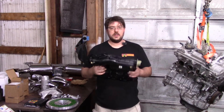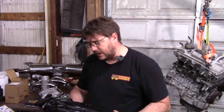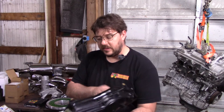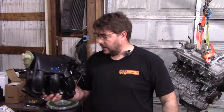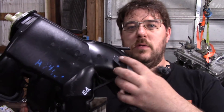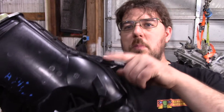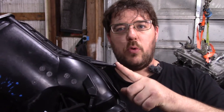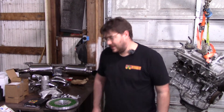To get a little more power — and I have to thank Alex here — Alex and I worked together closely on this latest tune. He did the dyno work, I did the tune work, and it worked out really well. One thing he did was buy all three intake manifolds available for this application and test them. The one we call number two is the one you want — it makes a little more power at the top. You can identify it by a crease on the manifold — that's the only version that has it. It came out of the Venza but showed up in many cars. This manifold only has one port, which is all you need; some have an extra port you'd just cap off.